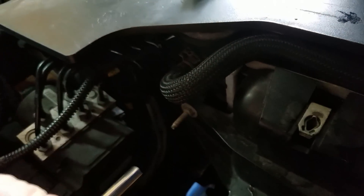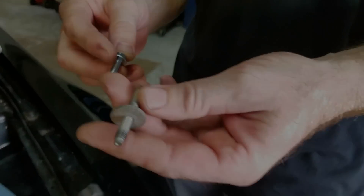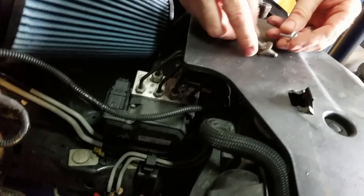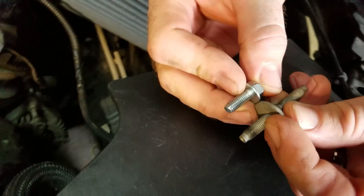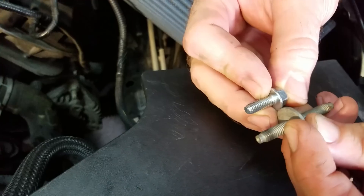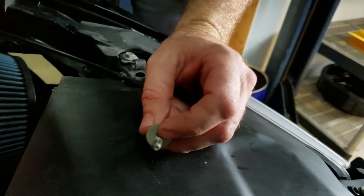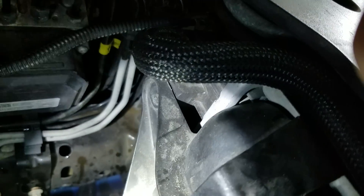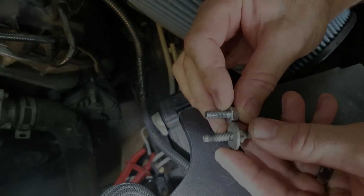I just realized this has to come off also and you have to replace it with a bolt that does not have a stud attached to it. This stud is for the cold air snorkel. You want to replace it with a bolt, but make sure the bolt isn't longer than the bolt you're taking out. Because if it is, you're going to put a hole in your radiator — it'll go through and right into the plastic intake and now you've got a coolant leak.